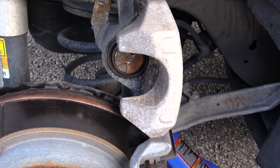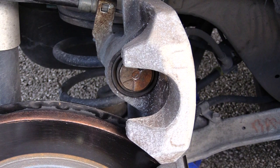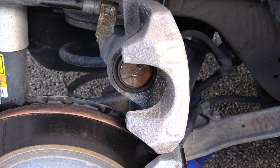There's a special tool you can use to spin these rear calipers back in, and I'd recommend getting it if you don't want to spend a long time with pliers. Once you get the piston spun back in, remove your old brake pads, put new brake pads on, put your caliper back on, and you're done.